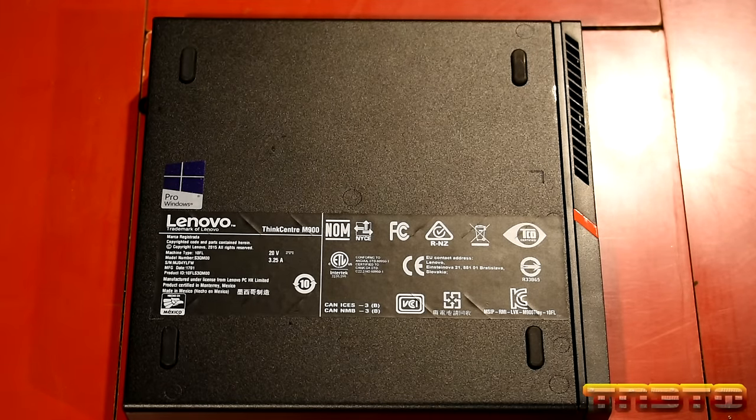We got startup, primary boot sequence. So here's where you can configure your default boot drives. I will do this later on. So by default, you want to have this at the top. So I want this. How do we change this? Use up down arrows to select device. Plus and minus. I'm using the plus, but it's not going anywhere. Oh, there we go.